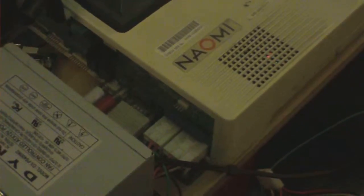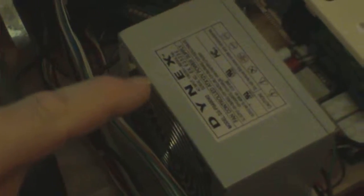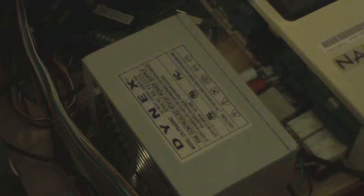I think the JAMMA one is one of the easier ones. Then there's the Capcom one, which will actually power the Naomi and has a connector to power it off a regular JAMMA power supply. That's okay if you're just using the Naomi alone, but if you're going to use the NetDim or the GDROM attachment, they recommend getting a PC power supply or a dedicated Naomi power supply — it's all about current draw. The standard JAMMA supply often won't be enough, and underdriving your equipment can cause complications. This setup can be quite expensive to get into.